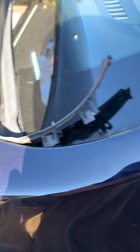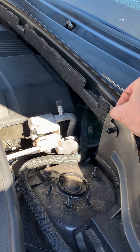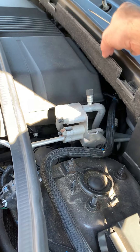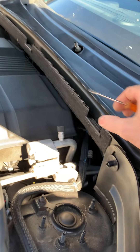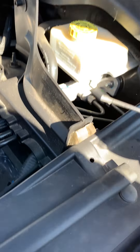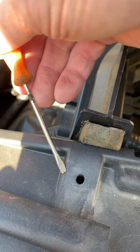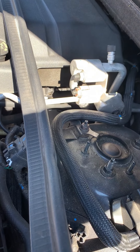You'll do that on both sides — you've got three tabs on the driver's side and three on the passenger side. Once you do that, you have this big piece of weather stripping that comes across in front of the cowling. It has three tabs — one here, one in the center, one on the other side — that rest down in there. The weather stripping just sits down inside there with the infamous little plastic plugs; there are just two of them. I just use the screwdriver again to get down in the hole and gently pry it up, and it popped off and comes right off.